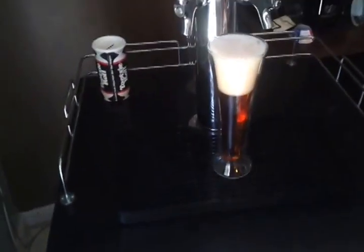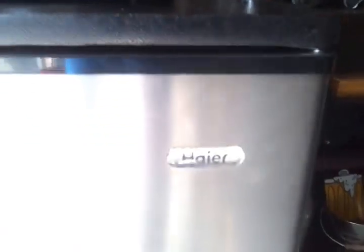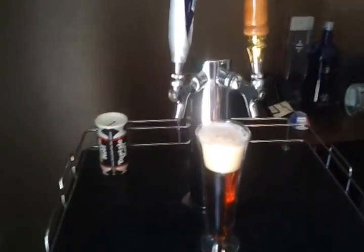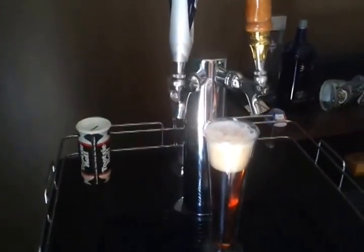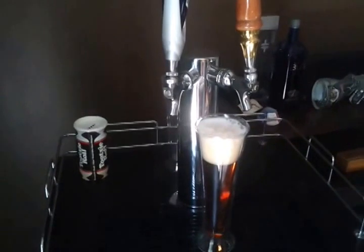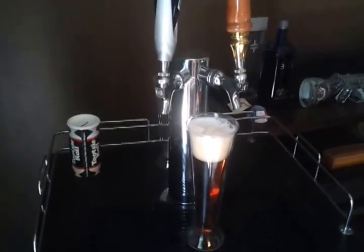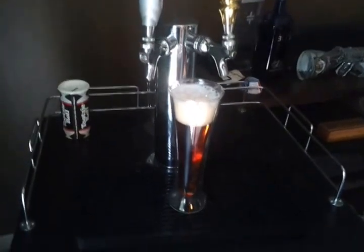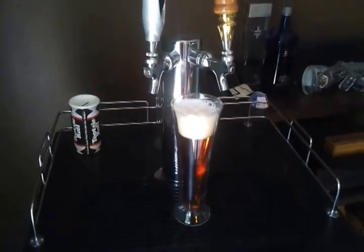So hope this helps any of you guys having problems with these Haier refrigerators conking out on you. Do a few YouTube searches of how to ohm out a compressor and how to charge it with the HVAC gauges, and you shouldn't have a problem. Remember, 7 to 8 psi is optimal. At least that's what I was able to get this refrigerator going with.